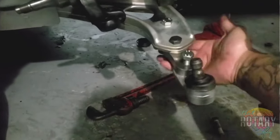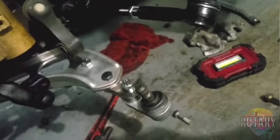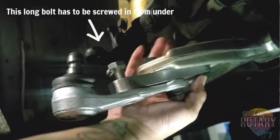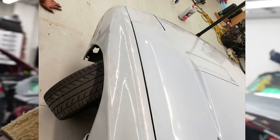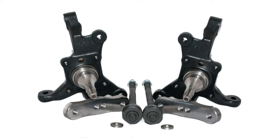Installation is a little bit tricky — I was confused for a bit because there were not a lot of videos to go off of. I had to piece everything together by watching different videos across YouTube, but I was fortunate enough to install it correctly. Once you install this kit, you will gain 55 degrees of steering lock with around five degrees of Ackerman. The kit includes their signature modified knuckles, inner and outer tie rods, 48mm bolt-on lower ball joint extension, and rack spacers for the extra angle.